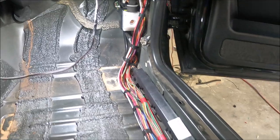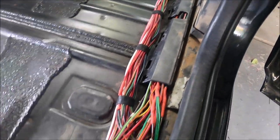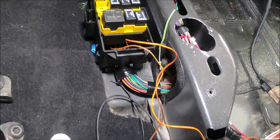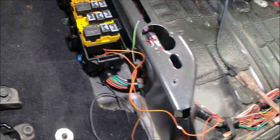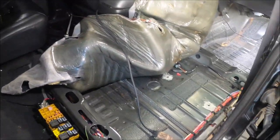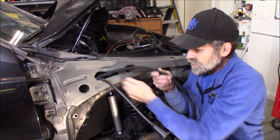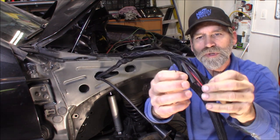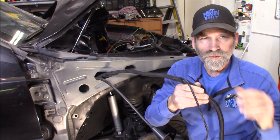With this part of the harness all installed, there's the end result here. I got just a few wires right there to take care of — and that's for the hydraulic cooling fan. I've got to mount a resistor back here because I uninstalled that fan and put an electric fan in some time ago, so to keep the ECM happy you've got to throw a resistor in here. I'm ready to lay the carpet back down. I've got all the necessary wires passed through the chassis here — as you can see, they're coming out right here — and I went ahead and covered it with a braided split loom. I'll put a link in the description below for this stuff. It does a nice job — looks better than original split loom with all the ridges; this is a much smoother look.